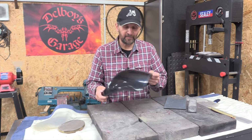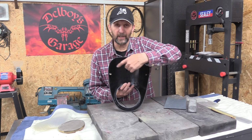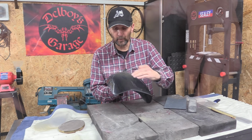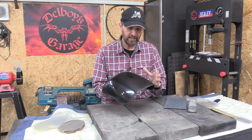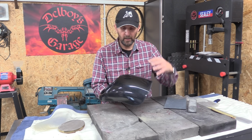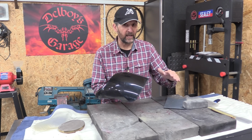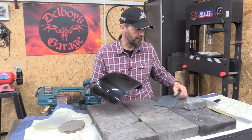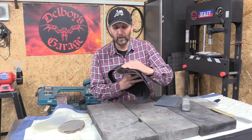Right, the next thing, now the lip is perfect, is to deal with these three little blemishes on the outside. These have come from the fact that on the inside there's three brass threads molded into the plastic. And where this plastic is extra thick to hold those threads, it's left these little dimples on the outside. They're virtually undetectable to the touch, but you can see them when you ripple it back and forth, and I want them gone. So the easiest thing, rather than just jump straight in there and fill them up with filler and then try and sand that filler flat: you can't block sand filler on a soft plastic panel, because as you're sanding the filler, the plastic's so soft, you'll be sanding that as well, and you'll never truly get it flat. A far safer way to do it, as it's so thick, 4mm thick, this plastic, remember, is to take some 1200 paper and my block, and very carefully just buff these out, just stroke sand them away until they're completely gone. And that's a far safer way to do it.